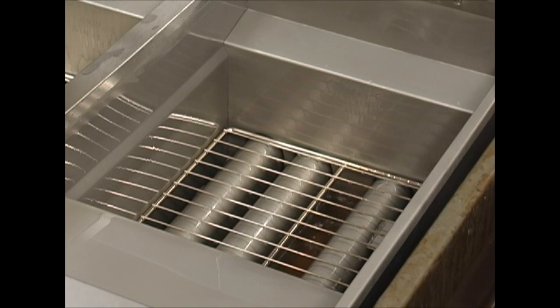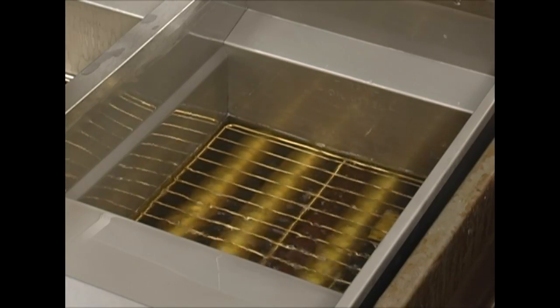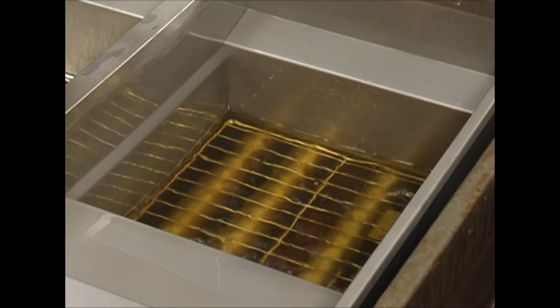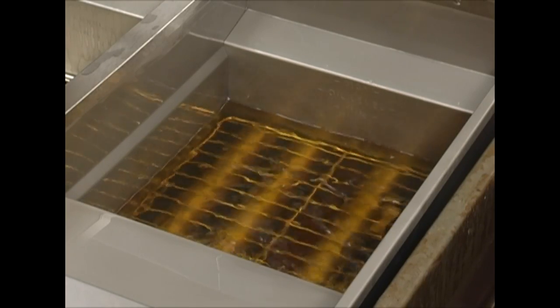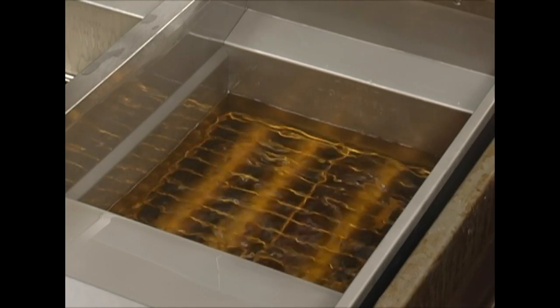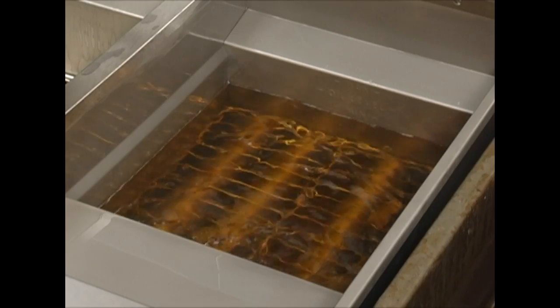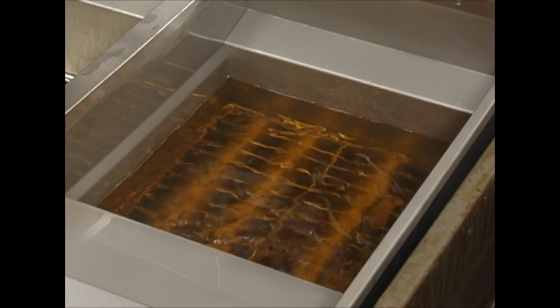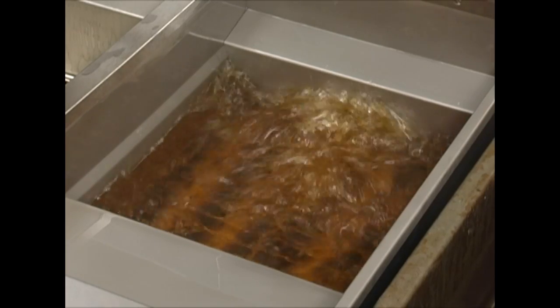This is real-time footage of the tank filling. The filling process should be less than one minute. If it is noticeably slower than this, check the cleanliness of your paper or continue to watch to see how to check the strainer cap. It is also possible that the oil is too cold. Was it between 300 and 350 when it was drained? Don't allow the oil to sit in the filter pan for too long before filtering. Once all the oil is pumped back into the tank, you'll start to see bubbles emerging from the oil. Allow the pump to run for an additional 10 to 15 seconds to return any leftover oil from the filter pan or the filter return lines.